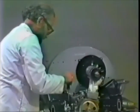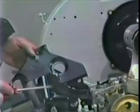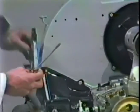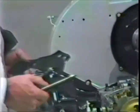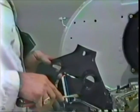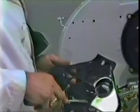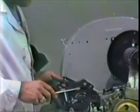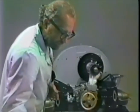Okay, let me go out and show you the side vertical pieces and what to do to them. Okay, the Zenith side vertical shroud has a little cutout here, a little jog. This jog will interfere with the Solex air cleaner intake manifold. You won't be able to get it over the Solex intake manifold. So what you have to do is cut that out, either on a grinder or with a pair of tin snips. And you actually have to bend this area up, sort of vertically to clear also, and then bend it back down after it's down, and the reverse of that to get it off again. That way you can use your Zenith side vertical shrouds on Solex intake manifolds. Okay, so let us put them on now.